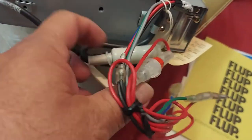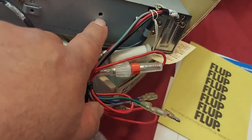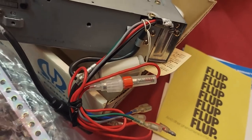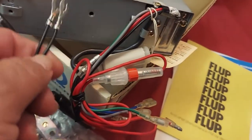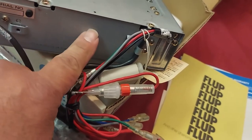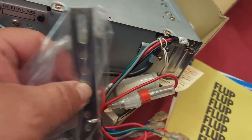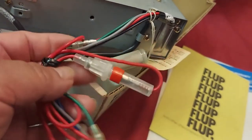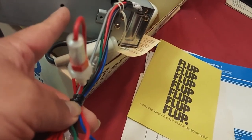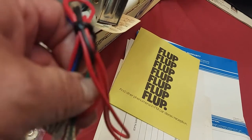This is the rear of the unit. Antenna. This is the mounting hole for the rear strap, also for your ground. The bolt goes through here and it also attaches the strap. So you have the ground wire that comes from here, your positive to this fused wire here — the red one — and these other wires are for the speakers.